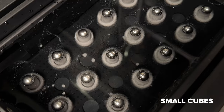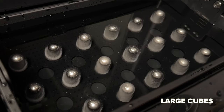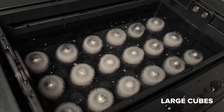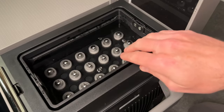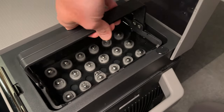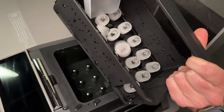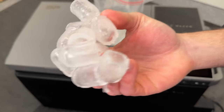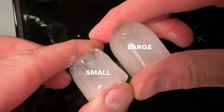It's really cool to see the ice form on each of the metal pins. Large size ice cubes take around 14 minutes. Once the ice is made, it automatically runs a release cycle for 30 seconds that warms up the metal pins and releases the cubes. You pull the tray out and use the scoop to remove the cubes — I recommend storing them in a zip-lock bag so you can break them up, since they tend to stick together because they're very wet ice cubes.